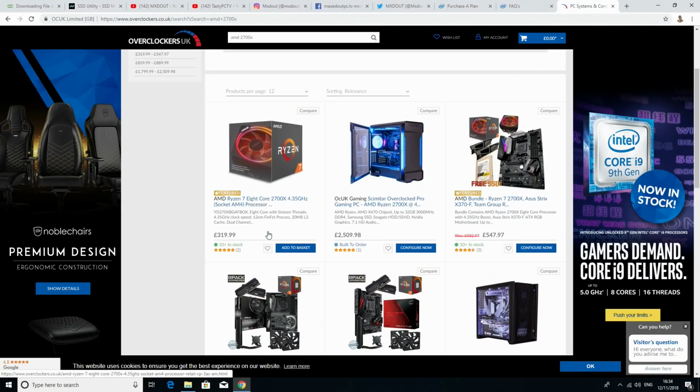But you can see definitely that's half the price and the same sort of speed, and technically in real world results, you wouldn't really notice it with a 9900K against the 2700X. But if you want the thought of having the most powerful CPU out there for gaming and stuff, then yeah, the 9900K. But technically no, if it's at 95 TDP, because I swear the 2700X beats the 9900K at 95 TDP. But when it's running unlimited, it would definitely beat the 2700X, and it's a better overclocker.